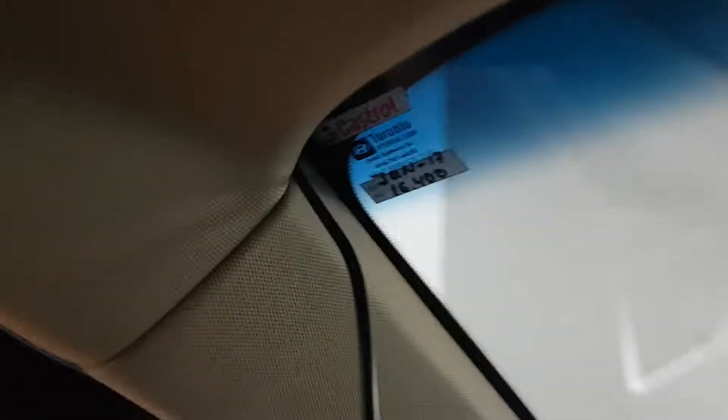There are cheap plastic trim tools available, but I use a simple round key — it works perfectly. I just fit it in and push the wire through. The hardest portion of the installation is fitting the wire through the seam on the pillars. That seam is a little tighter than the one by the windshield, but it's very easily doable — just apply some pressure right through the seam, bend it off a little, and feed the wire inside.